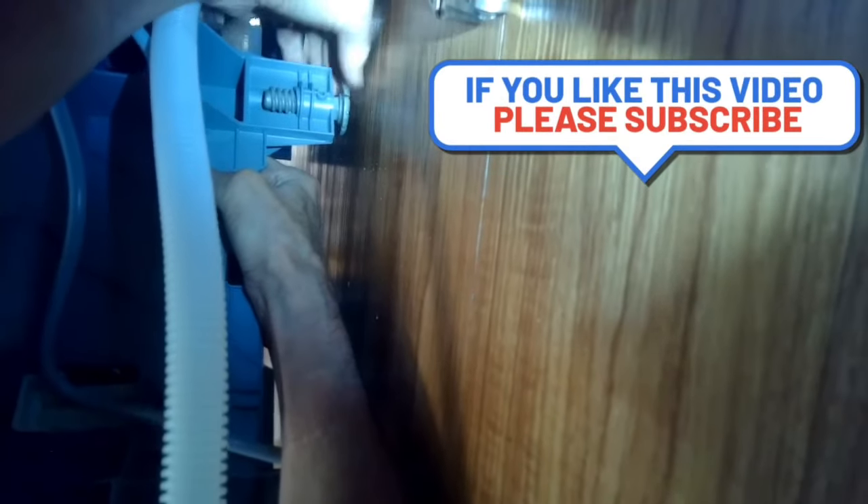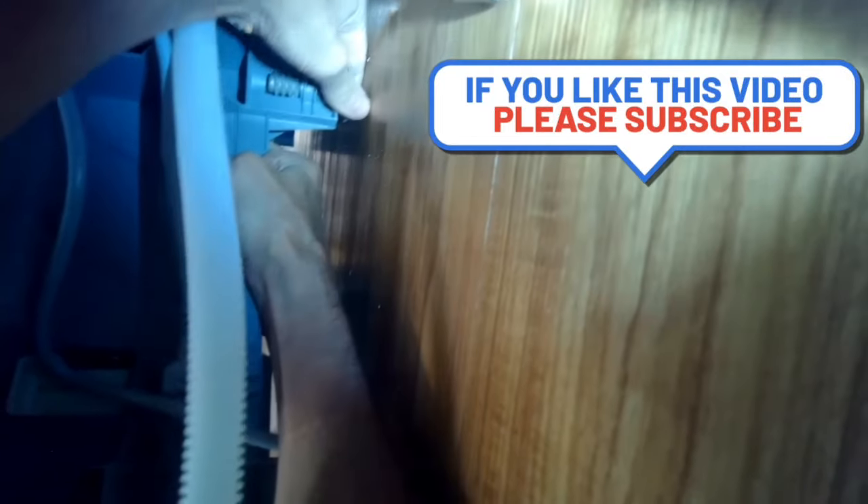Next we'll hook up the power connector right here. While we're back here, this little guy is what can raise up the back of your dishwasher — you can spin it by hand, use a wrench, or put a screwdriver in the slots and turn it. Going left raises the back of the dishwasher; going right lowers it. There'll be some in the front too for adjustment. At this point I'm going to start feeding some of these things — the drain hose and the power cord — through the hole in the cabinet to bring them underneath the sink.